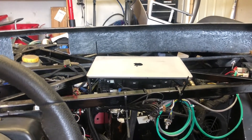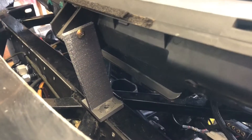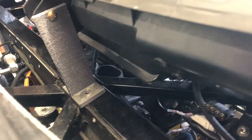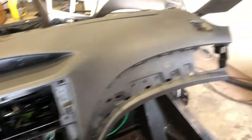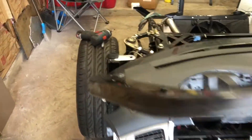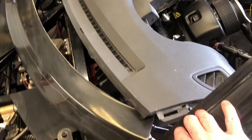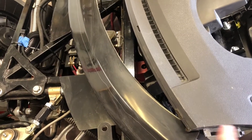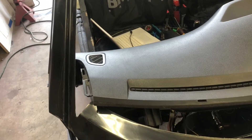It's all done now. The brake and clutch switches that go to the ECU pass 12 volts when you're not pressing the pedal — if it doesn't get a signal it thinks the pedal is pressed. The cruise sends 12 volts to turn on, down sends 12 volts to one pin, up sends 12 volts to another, and pulling in for cancel sends 12 volts to the same pin as up and down — that's how it knows you've got that extra pull. All done. The part for the center dash brace finished 3D printing. I'll grab some lunch and then see how that brace fits up. It holds really steady, not rocking back and forth.